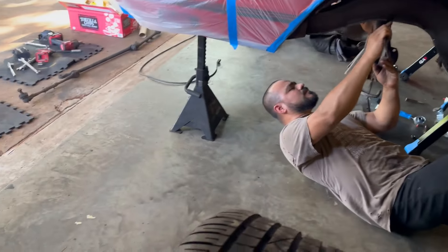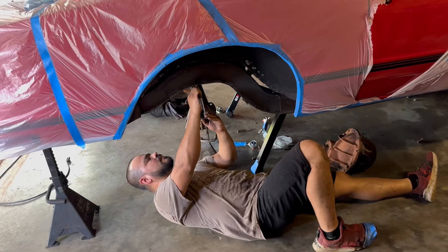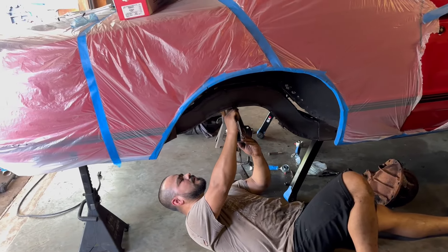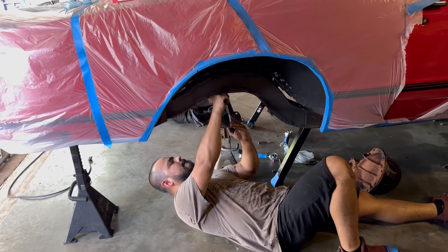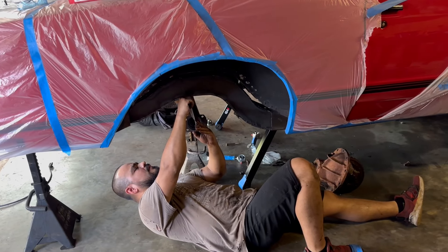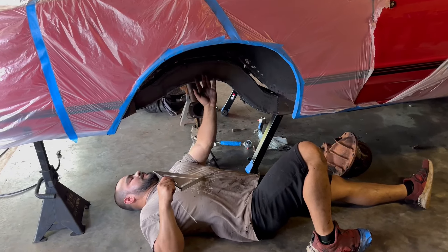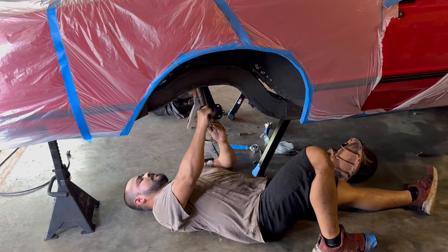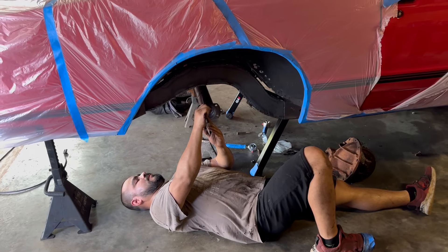So we're taking our measurements here so Andre knows how much to cut from the axle or from the rear end, and it'll also tell him the right size axles to order — the right length. I'm also checking for clearance for the brakes. From here to the flange it's two inches, and then you have three and three-quarters on the back space.